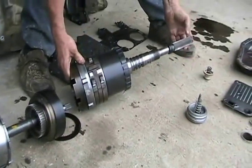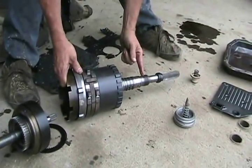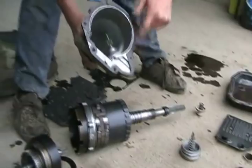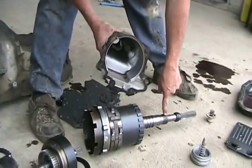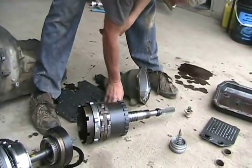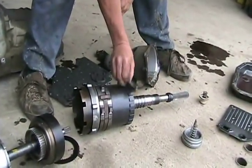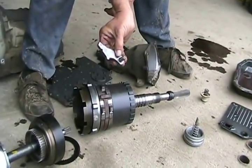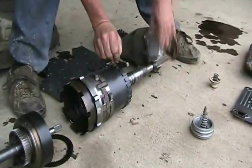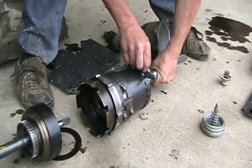This is the final output of the transmission — this goes to your drive shaft. That helical-cut gear is for the worm drive for the speedometer pickup. Inside there is a little plastic gear that rides on those gears, and that's where you hook your speedometer cable to. All these notches back here are the thing that goes click, click, click when you put your car into park. This little actuator arm grabs one of those notches — and that's park on your car. That's all that holds your car. If you put your car into park while it's still moving, this goes click, click, click through all those little bumps.